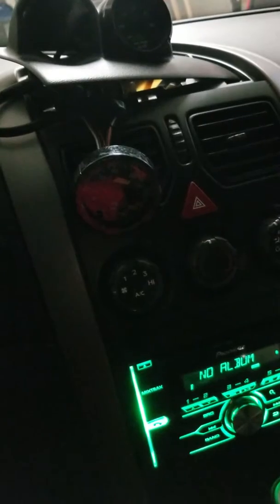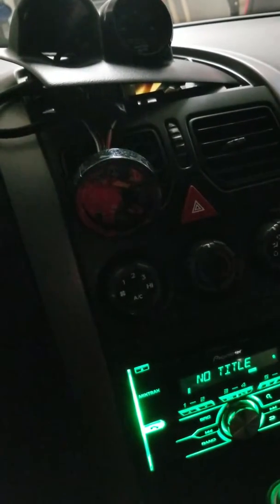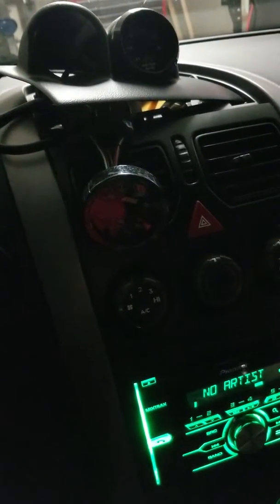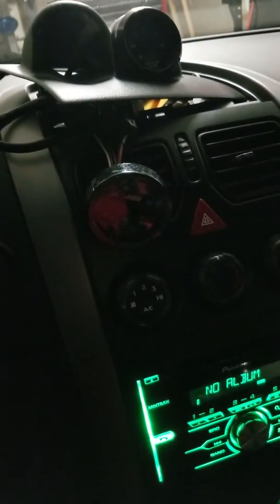At the sensor, I got 4.83 volts on the red wire, 4.38 volts on the green wire, and then there's a black ground wire. That's the plug for the sensor.